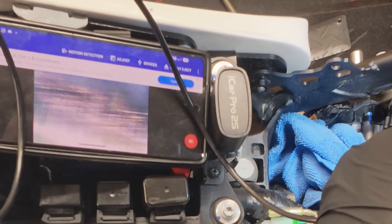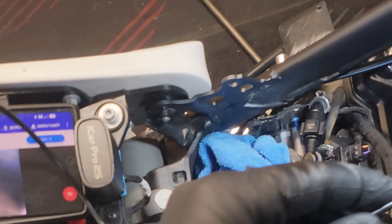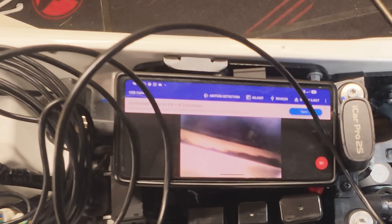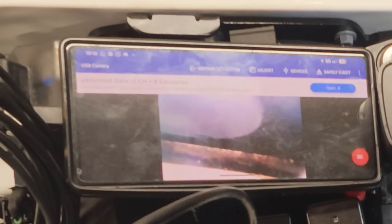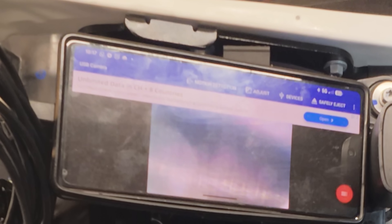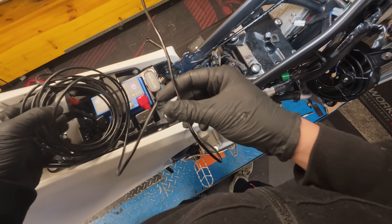There are some slight wear marks, but you can still see the cross-hatching. Moving it up, you see top dead center where the piston meets, and there is a bit of build-up up there, but that's nothing unusual — that's mostly the intake side. On the exhaust side, you can actually see the exhaust valve up here, and you can perfectly see the cross-hatching. There are some slight marks, but that's completely normal. You can see some marks at the exhaust side, and the factory cross-hatching is still visible.